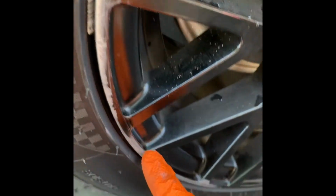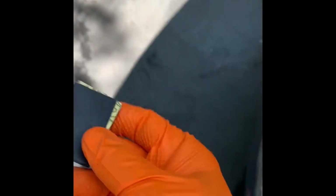It hurts, but it is smoothing out. But these are pretty deep. These ones right here, they're pretty deep. So I think that physically I still might be able to feel this roughness no matter how much I sand, because I don't want to mess up the shape of the lip too much more. Probably stop here, grab the 1000 grit sandpaper, and finish it off. So we're still gonna have those gouges, but at least any other surface that isn't as deep will be smooth.